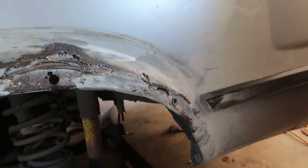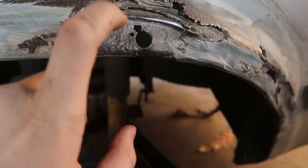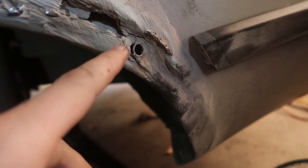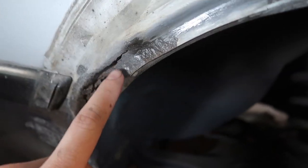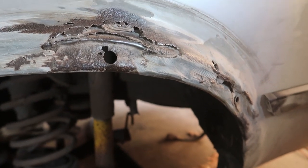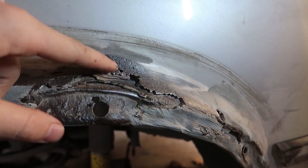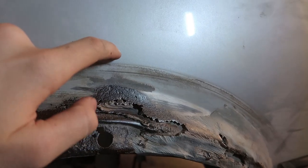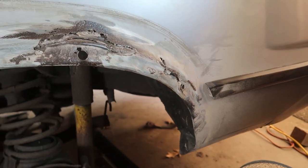After some serious grinding I've discovered there is tons of bondo that somebody must have used on this car a very long time ago. I am kind of pleasantly surprised though — I am finding actual metal underneath and it's sturdy enough to hold a fender flare. Any spots that are starting to rust have bondo over and under them. Luckily some sections don't have much, so I'm just trying to grind it down to as much bare metal as possible so I can seal it and it won't rust again.